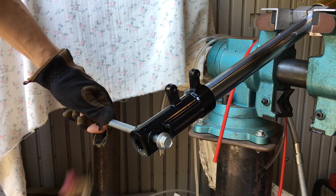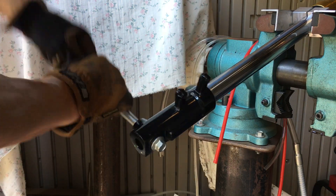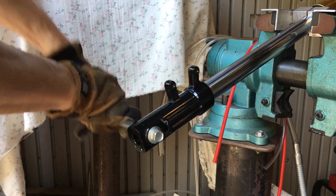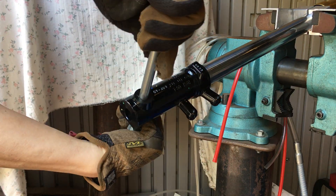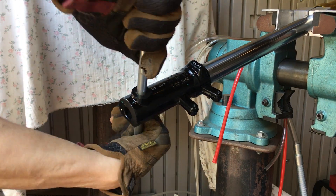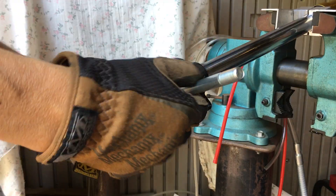This side is actually easier to do than the other leg, because the other leg has the brakes mounting, so there's more mass and it takes even longer to heat up — that one took me forever. As you spin the bolt, if you feel like it's getting tighter, put the heat gun back on it, because what's happening is the Loctite is cooling down and hardening up again.